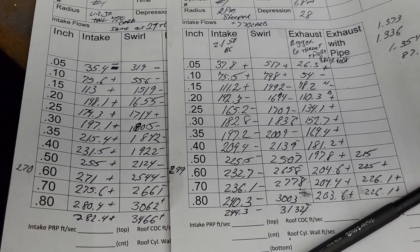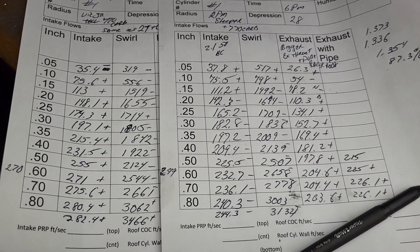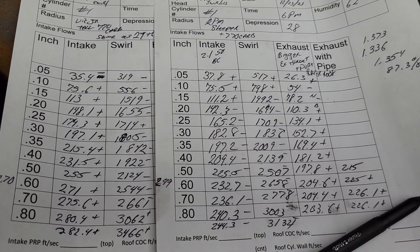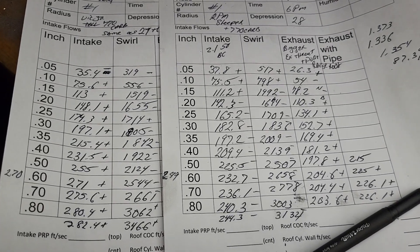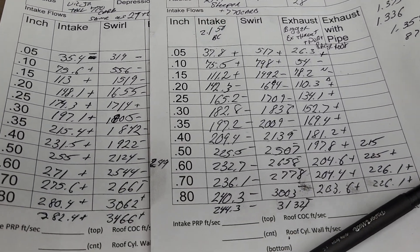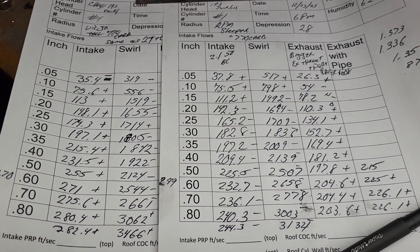I keep bringing Chad Spier up because I absolutely love his super stock work. Forgive me if I get the numbers wrong — his 172 cc super stock heads flow 282 CFM, and through the manifold either 270 or 260, making 585 horsepower or more. You'll have to look it up on Chad's YouTube to straighten me out. In any case, this is not super stock — it's a much bigger port: 228 cc's instead of 172, but still flowing a huge amount.